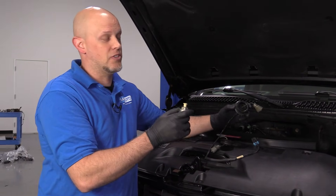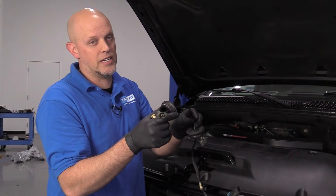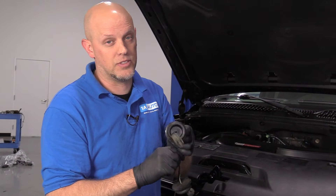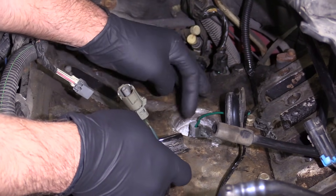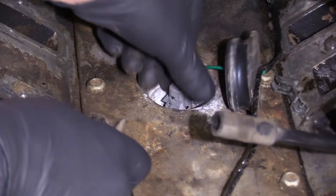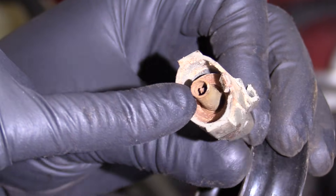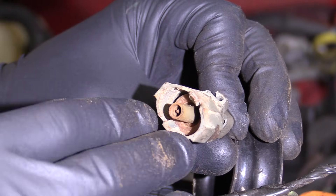Because of the location of these knock sensors being underneath the intake and not being easy to get to, it's always a good idea to replace the wiring harness while you're there. These get brittle over time. There's a lot of heat around them, and they're not that expensive, so it's a good idea — just replace it. You may have a condition like this where you've got some corrosion. The old harness was all corroded; some moisture and water got in there, and that's what actually caused the light on this vehicle. In this situation, you're going to want to replace the sensor and the wire because there's too much corrosion — you're not going to clean that out.